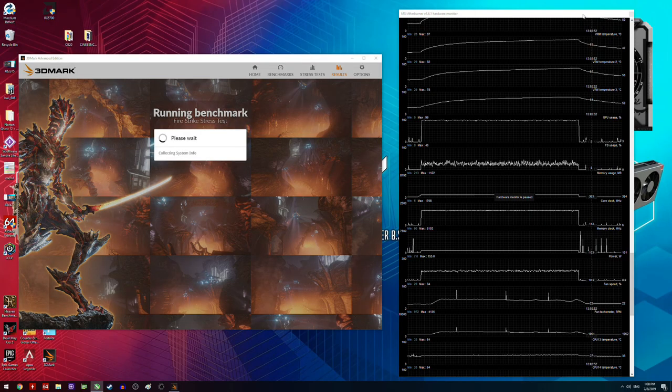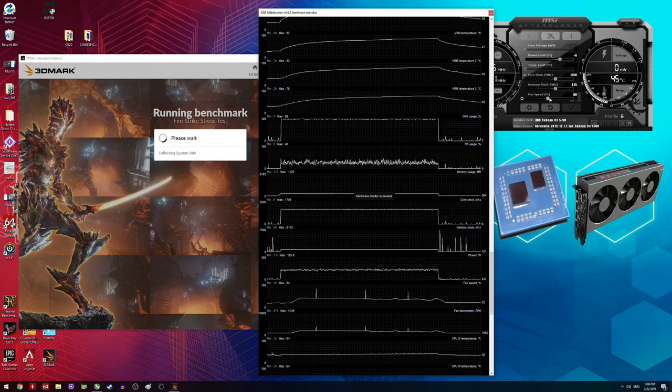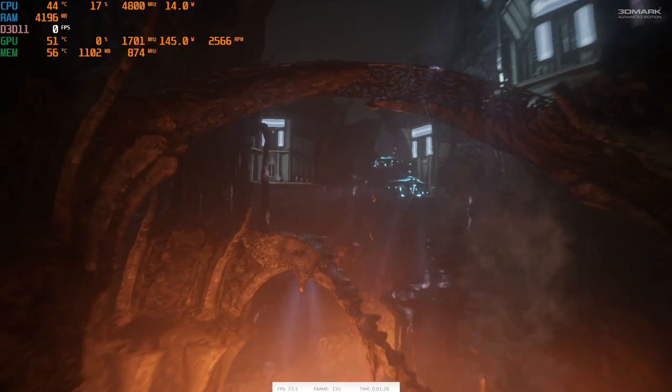So then I slapped on my new cooling solution, and I actually adjusted the fan curve so that it was less audible than the blower when it gets full ramp going, but I had to up the RPM on the fans because they aren't as loud. They can work a little bit harder for this solution.